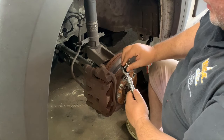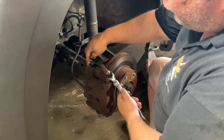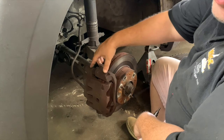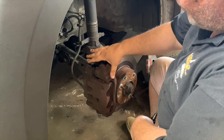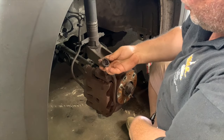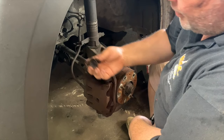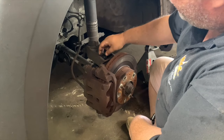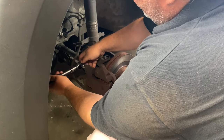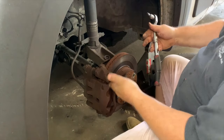This procedure with the six-millimeter hex is going to be the hardest part of your job, because you run the risk of stripping out that slide. And if you strip out this little six-millimeter Allen, you're done for — you're just going to have to buy the whole thing new. You could technically drill it out, but you're not going to. This stuff isn't super expensive, but this is actually the hardest part. What you'll do is prise off this cap — you can see some of the purple grease we have in there from before. It may take a screwdriver. There may be a metal retaining clip holding this cap on. This cap is actually super vital: it keeps water out of this area, and water is what does these things in. You'll set your ratchet to righty-tighty lefty-loosey, go in here, and we shall see what we shall see.